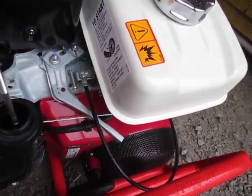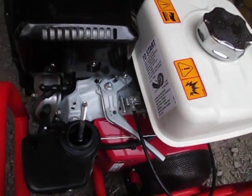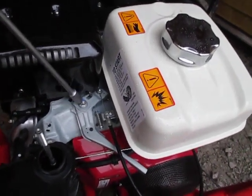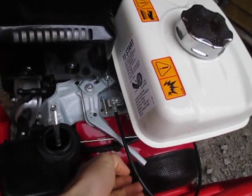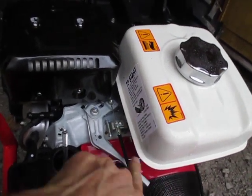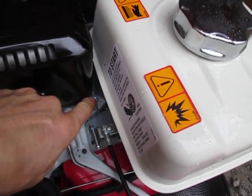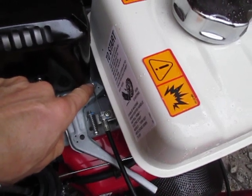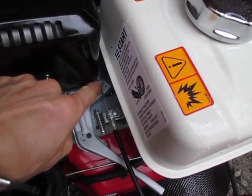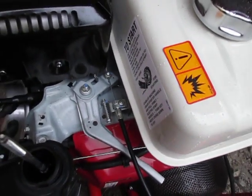Once you receive your new throttle cable, thread the new cable down through the handlebars from the top end. Make sure to loosen this clamp again before you install your new cable, because that spring has to be pulling it back to the idle position — it should snap back firmly like that. Then thread your new cable through the clamp. It takes a Phillips screwdriver to loosen the clamp screws, though some take an Allen head screw and some take a slotted screw — it depends on the style clamp used, as they've used different things at different time periods.